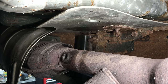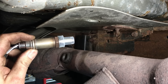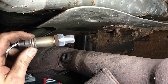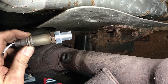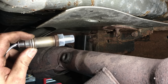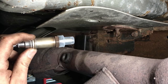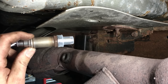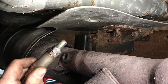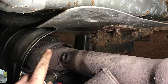Since we're talking about O2 sensors, the ones you want in my experience are the Motorcraft ones. A lot of these have a certain calibration attached to them just for a certain 49-state or California application, and of course the different engine sizes and calibrations that come with that. Just use the Motorcraft ones and be done — you won't have any problems afterwards. These come with anti-seize already on them, which is good to go and will help lubricate as we thread it back in.